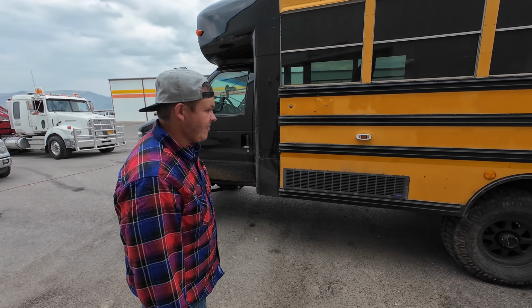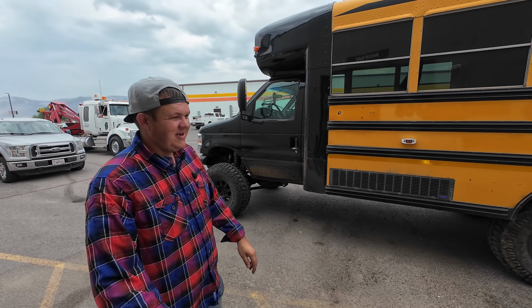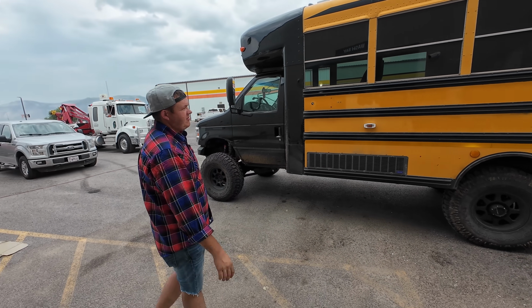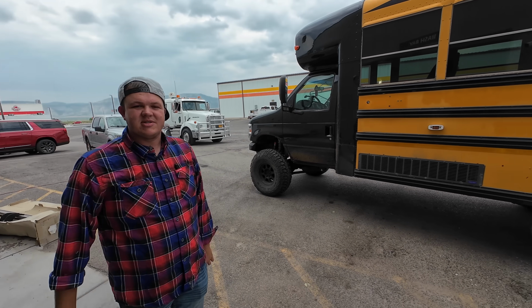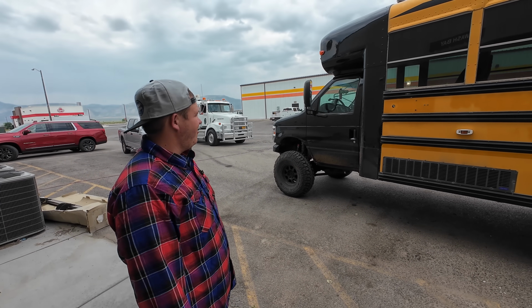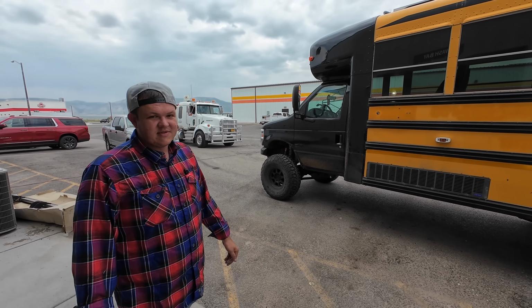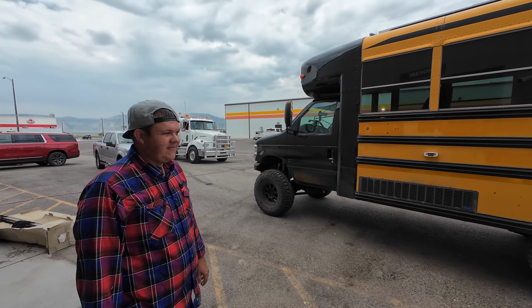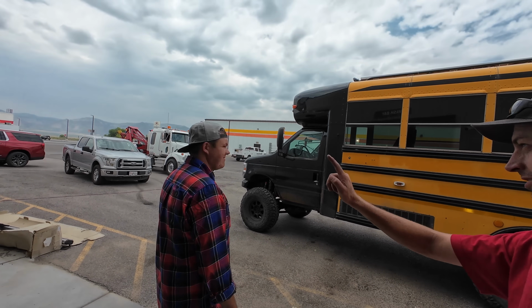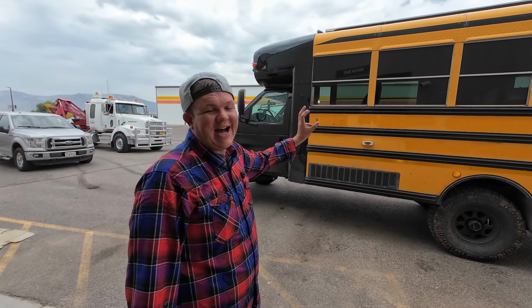Yeah, so what's the plan with this now? So I've got 5 gallons of gas. Well, you've got other modifications you're gonna do to it. The only thing we're gonna do to it is put new leaf springs and sway bars to pick the back end up and then stabilize it. Level it out, stabilize it. Ultimately, this is a 6-inch lifted bus with 38-inch tires. It's gonna have some sway. It's not a stock bus anymore. But the part of the wiring that failed and made it break down is stock wiring, not Robby modified wiring. Nope. The modified wiring is standalone, isolated in the back.